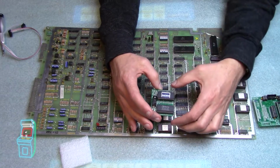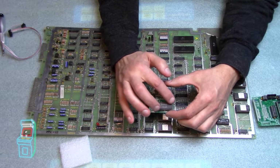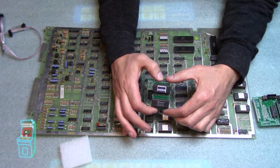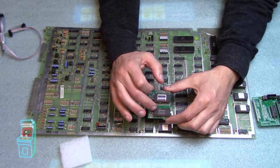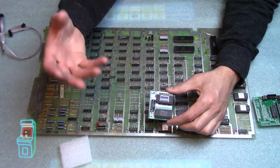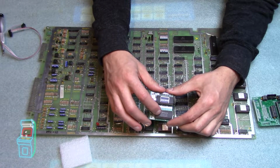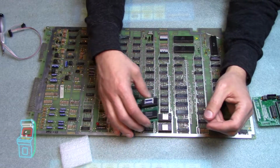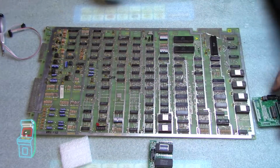Since I'm beta testing this, you may not get this one that's flash programmable. It might just be one that's hard coded. I'm not really sure. Again, this is beta. I'm able to actually overwrite this chip right here depending on the revision, like if we find a bug or whatever it is, we'll let Joe know, and then he'll just reprogram it and send us a file. And then at my house, I have a burner, which I can take this chip out and reburn the new image onto here, and then we try it out and see how it works. So anyway, that goes right there. You can see it's lined up where you can just put it over. So I'll put that on the side for now.